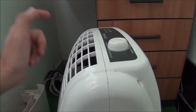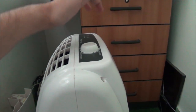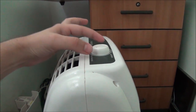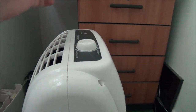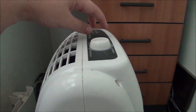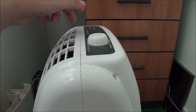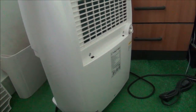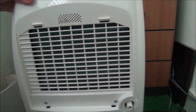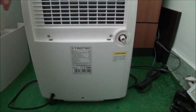This fan is way less than that for sure. You can probably just add one somewhere around here - I'll check inside, but most likely there is room. You would have a switch similar to this one for the fan right here. I don't recommend you get a switch that allows it to go down to zero, or if you get one of those, don't go down to zero, because probably this fan also helps cool the compressor itself. Going to really really low may not be a good idea. But yeah, enough blabbing - let's start opening this thing.